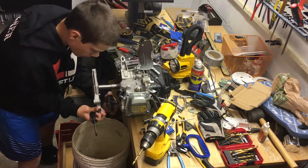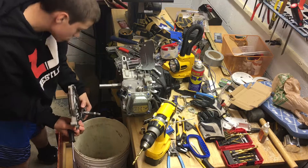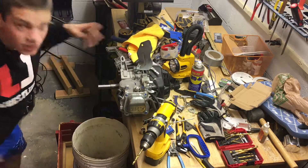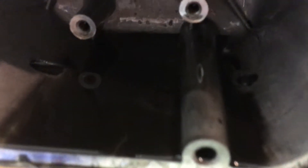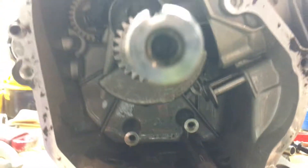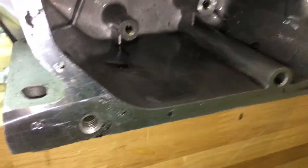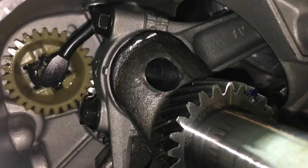Now I'm going to pull off the side cover of the engine. It just fell out. Let me bring you down so you can see what's going on here. In there, all that what looks like oil is just stuck — I have to scrape it off. That's probably a sign of not changing your oil. I got all the oil out with some paper towels and I'm going to take out the governor.